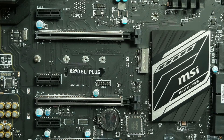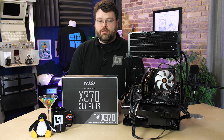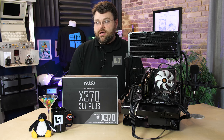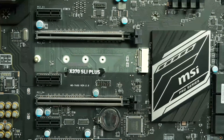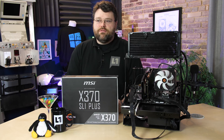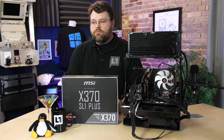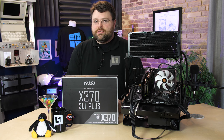In terms of board layout, we've got one PCI Express x1 slot at the top, which is great if you're going to use an oversized air cooler — which I'd recommend if you're going to overclock Ryzen. Then below that we've got our GPU PCI Express x16 slot. Then below that we've got our M.2. I think this M.2 placement is a bit unfortunate because if you run a really heat-generating M.2 like the Toshiba RD400, it might not get the cooling that it needs through really long write cycles.